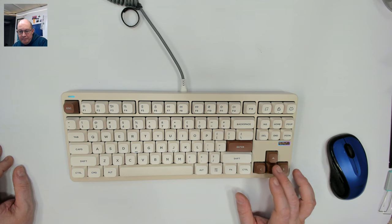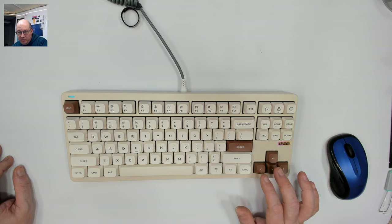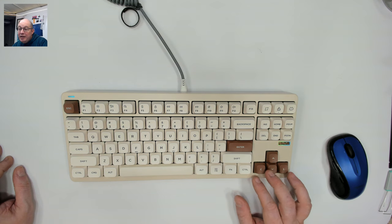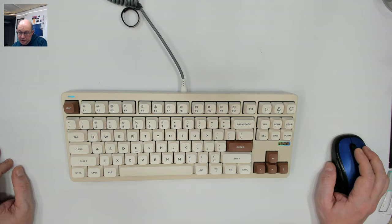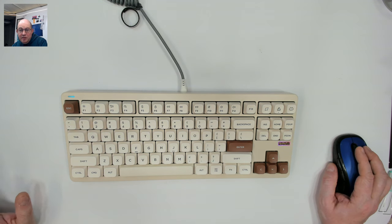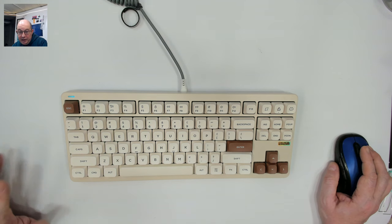The silicone bean, slightly less bounce, but more than the strip, with two hardness options, 30 and 70. We have the silicone strip, which they say is the most balanced feel choice. And then we have the screw and silicone top mount for firmness, and the silicones are to be used with the screws. So, all right. And we have the bottom silicone layer, a PCB foam on top of that, and then we have the sound dampener, which is the PET layer, the switch pad, which is the IXPE, and then the plate foam that goes between the plate and the PCB.